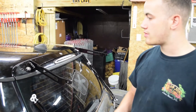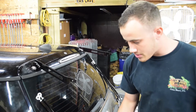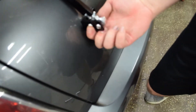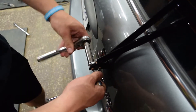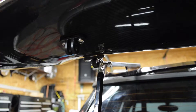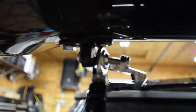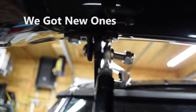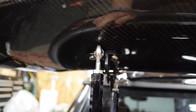We just tightened the top brace fully — put a flexible washer, some silicone, tightened it up, and it's all secure. Next step is to put the four rods on, tighten each individual bolt nut, then place the wing on top for real. But we've run into two more problems: these rods are bumping onto the bolts on top so we won't get as flush a finish as we'd like, and the rods on the back side are too wide to fit. Fitment on this kit has not been good, to say the least — problems on both sides.